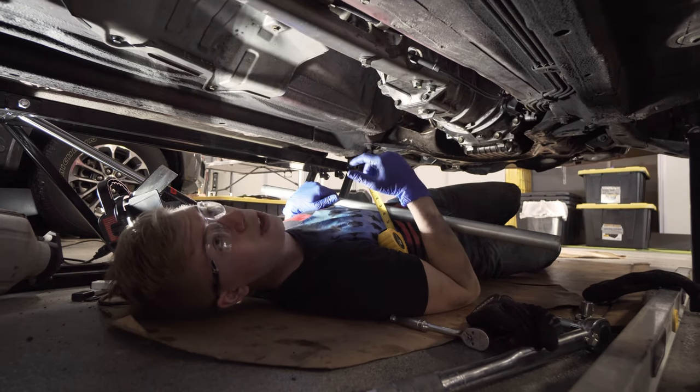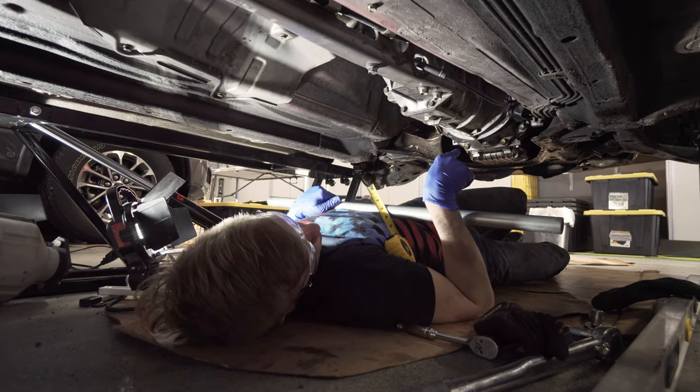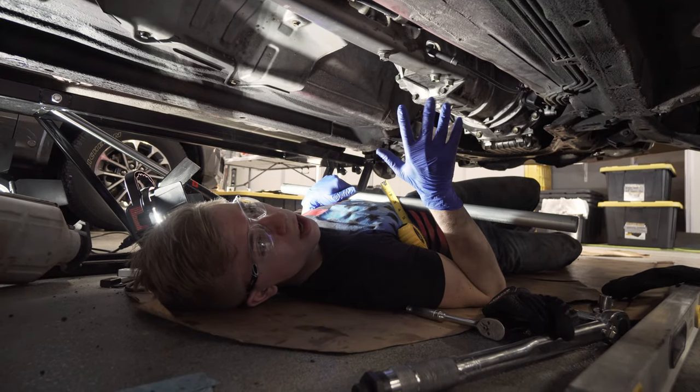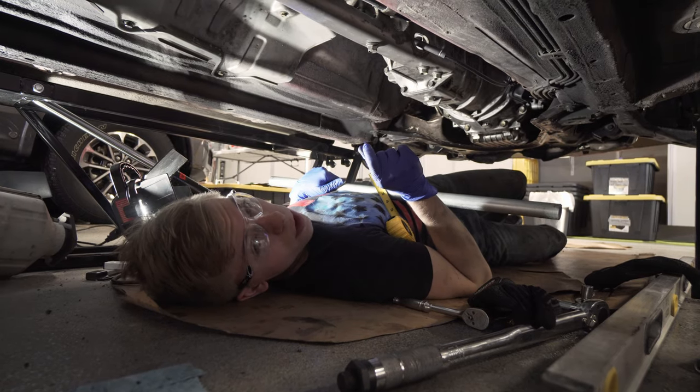From there, start bolting everything back together. Torque all your PPF, bell housing, and starter bolts, get the sleigh back on, and then get your exhaust back on and you should be pretty much good to go. Spend 500 miles of easy driving before you really get on it. You want to make sure that clutch is broken in and good.